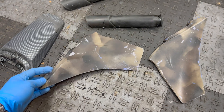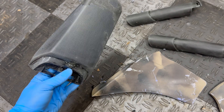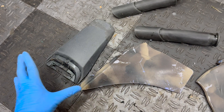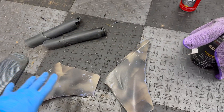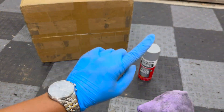Here's how the plastics turned out. My cuts are certainly not perfect since I'm doing it with a grinder — my Dremel broke. Here's how the rear fairing looks; I slimmed down the sides to match the width of the seat. We're going to use the fork guards too. I've got everything scuffed down, so we're going to wipe it down with some acetone and then lay down some primer.